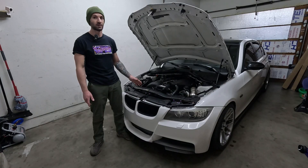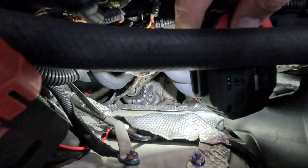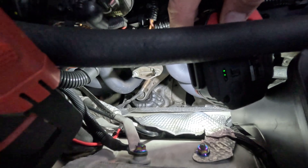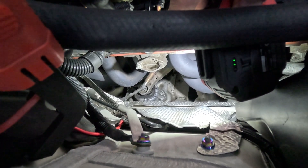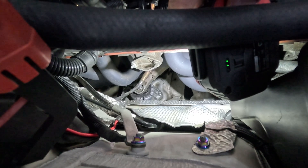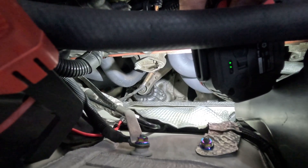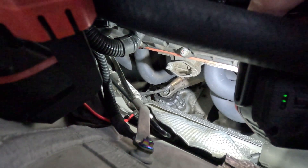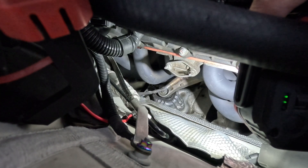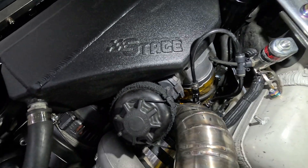The first thing you can do is inspect them visually. Look to see if the rubber is cracking, completely deteriorated, or dry rotted. You can also take a look at that aluminum engine mount arm that rests on top of the engine mount. If it's sagged down and the arm is contacting the aluminum frame of the engine mount, the engine mount is bad. You'll notice the engine mount arm is actually raised off the engine mount just a little bit.